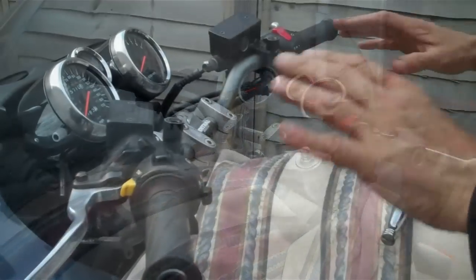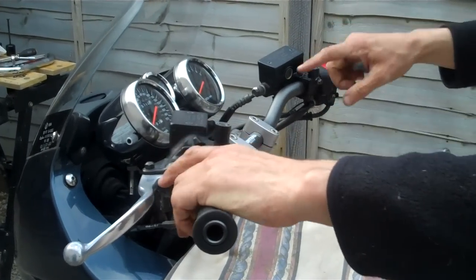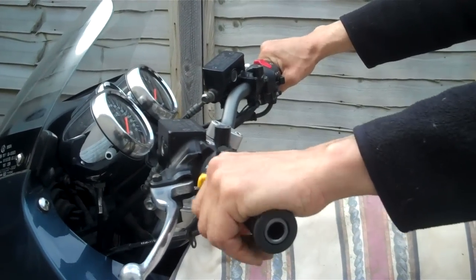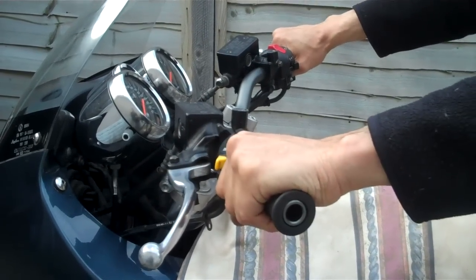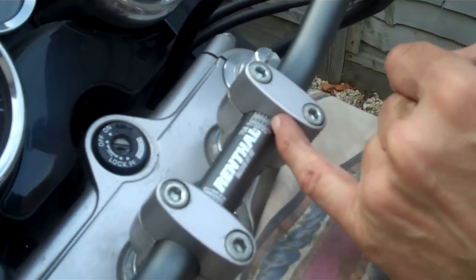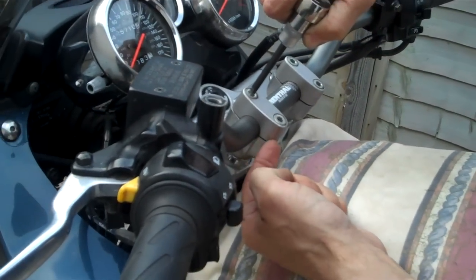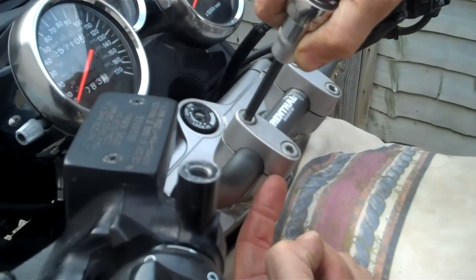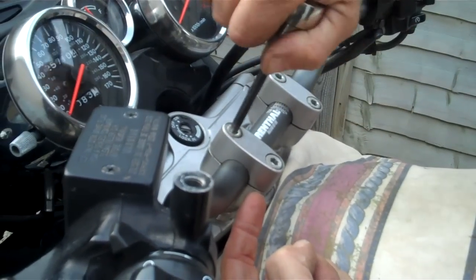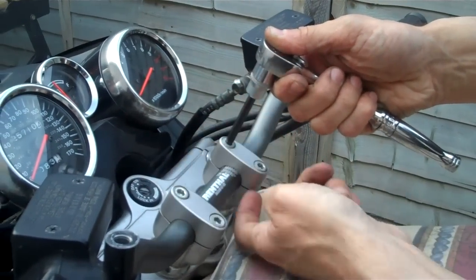Now sit on the bike and get everything set and lined up. Everything on the bars is loose, so the first thing is to set the bars at the height you want. Loosen off the clamp and sit them where you want them. On the top clamp, looking in here you'll see tiny marks each side — just set that so it's correct side to side. Make sure the gap here and on this side is exactly the same. Don't do one up till it's butted solid and leave a gap the other side — they won't grip properly. You don't need to lean on these, just wrist tight.